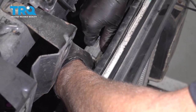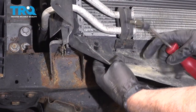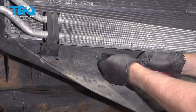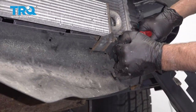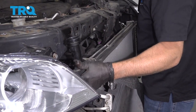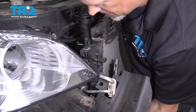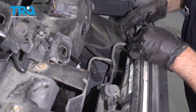Disconnect the connector for the fan — just push down on the tab and slide it out. This lower shield needs to come off; just use a trim tool to take these push pins out. Now just grab the radiator and slide it up slightly. You're going to pull it out a little bit, being careful not to damage the condenser. When you tip it down, you can access the transmission cooler lines right here.